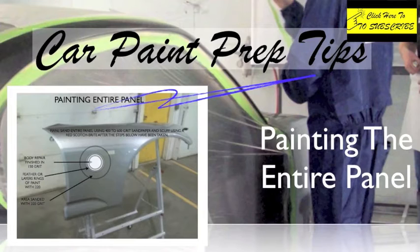But I generally like to go ahead and prep the whole panel and sand the whole panel before I do any priming. The reason I think that's a good idea is if any overspray gets on the unsanded area, it lands flat. Sometimes when you're priming, it just gets a little bigger than you intended. And if it's not sanded underneath the primer, that primer is going to peel. So even though you sanded the primer and it's smoothed up and looks good and feathered in, if it's not stuck to the paint good, it's going to peel later. So this way, if you have it all sanded, if your primer spot does get a little bigger than you intended, it's still going to be on a sanded surface that has mechanical adhesion.